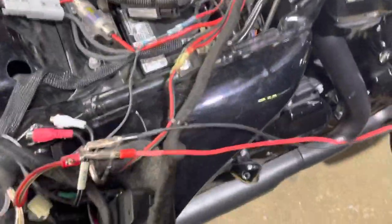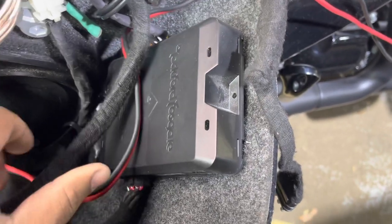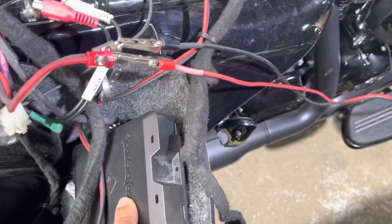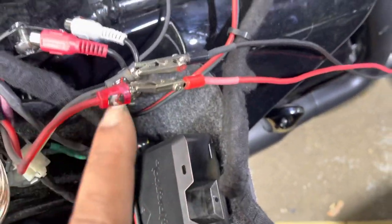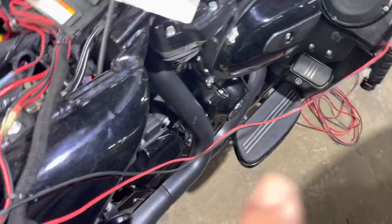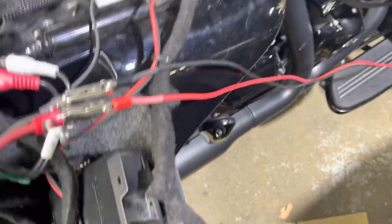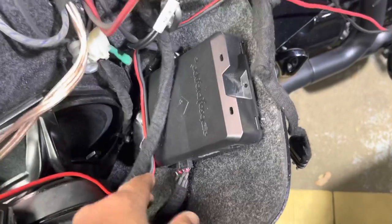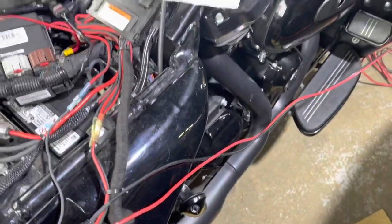Then you go into the bag and there's a DSR1 DSP. So instead of using speaker level and removing the line leveler and going speaker level to the DSP so you get full range, they went through the auxiliary with signal that's already chopped up by the line leveler. So the line leveler is blocking the low bass. Then you feed the DSP, which could take full range, 20 hertz to 20,000 hertz, and then feed it out to the speakers. So if you have this, you don't need that.